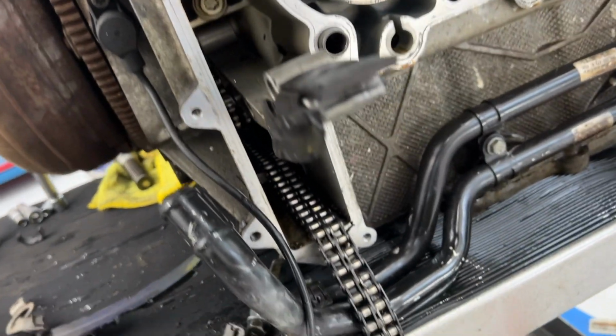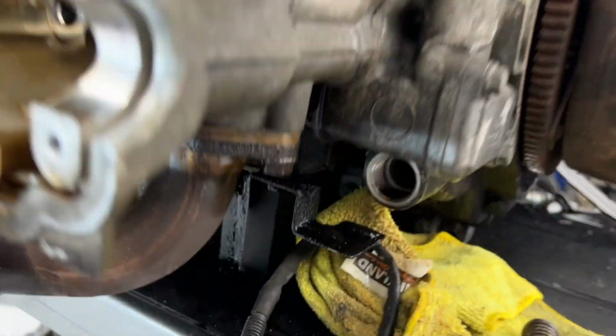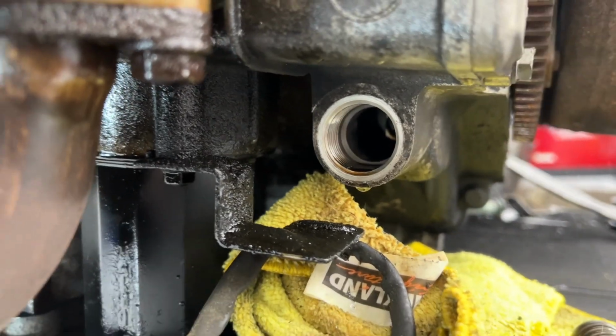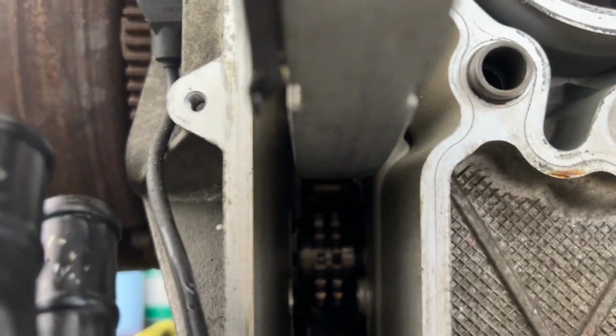So I'm gonna try to reach in there from the hole where our tensioner was and use like a pick or something to try to get over at the left at that chain that I saw that was all jacked up. Or somebody else had another idea for me that I'm gonna try first because it's easier, is to take a screwdriver or bar or something down here and try to push the chain down away from the sprockets. Maybe I can get it detached there and just drag it underneath. So another good idea. Let me try that first.